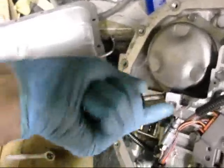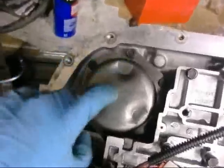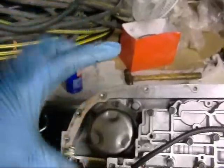Well, nothing ever goes easy. To get the servo cover on for reverse, when you put it in reverse, this piston goes psht, and it pushes a pin which squeezes a band against the drum. Yeah. Welcome to my neighborhood at 11 o'clock at night.